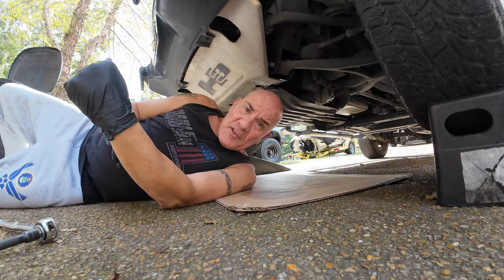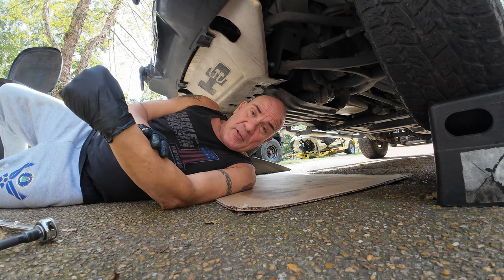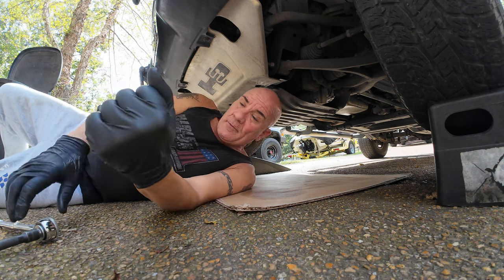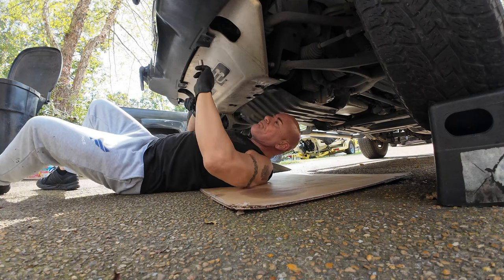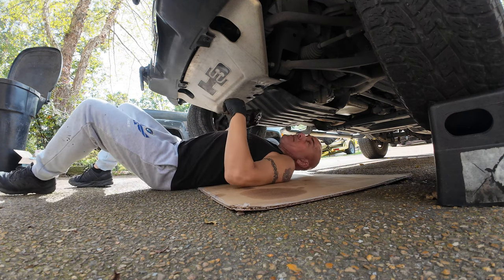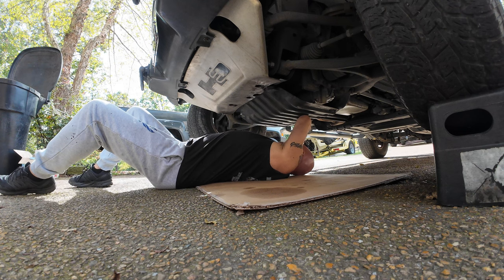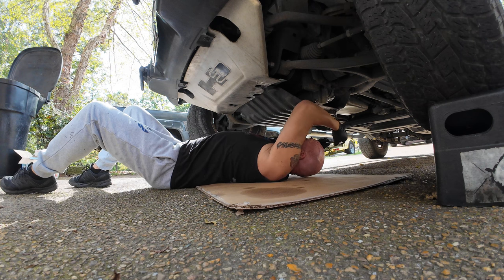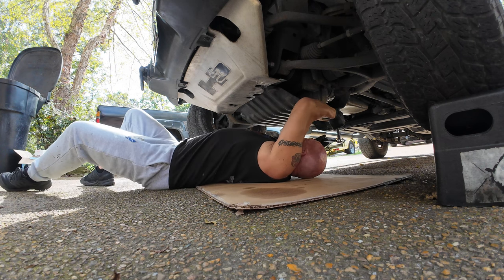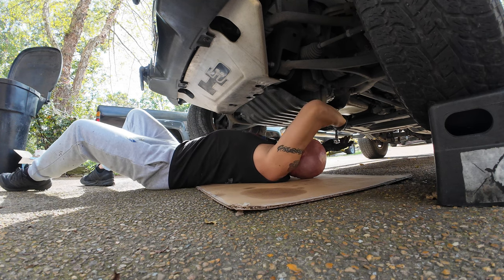The H3 has got two skid plates. You're going to remove both of those skid plates using a 13 millimeter socket, and there are 6 bolts. So I'm loosening up the bolts a little bit. These back bolts, you don't have to completely remove because they can just hang there. And you'll see when you take the skid plate off, there's an open hole that they can slide over to make it a lot easier.